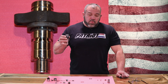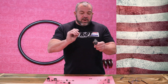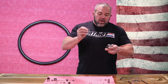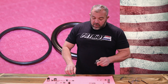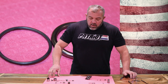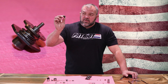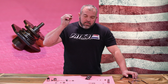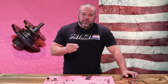There's an O-ring in the body at the very top — every single time, always a new O-ring. There's an O-ring in this part of the body — every single time, always going to get a new O-ring. We have an armature — fully assembled, loaded with a lock and a spring — and if you motion this thing just correctly you can physically open it and close it.